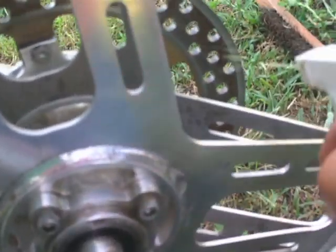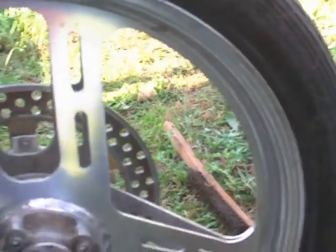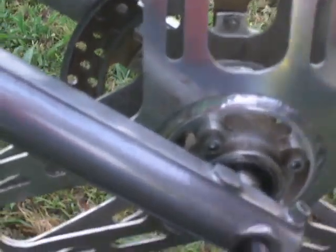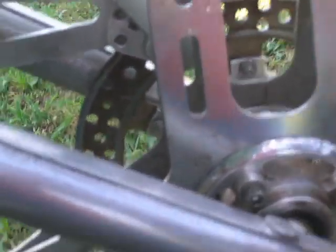I got your calipers all clean. Lubricate the pistons — little teeny bit on there — and you rub it, it takes all the rust off the discs. You don't want that rust to go in the pads, because that'll take away 40% of the ability of the pad to brake the speed. Rust will glaze over the discs really bad. You run that around a little bit and that won't even affect it. You'll get a better bite because you've got nice clean steel. The rust rubs right off of it.